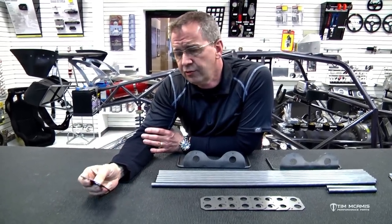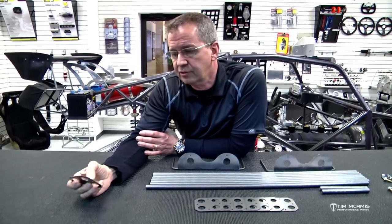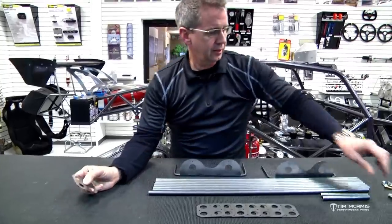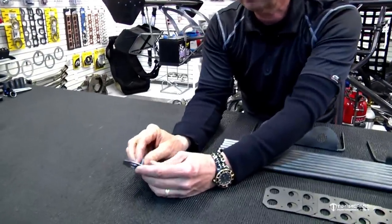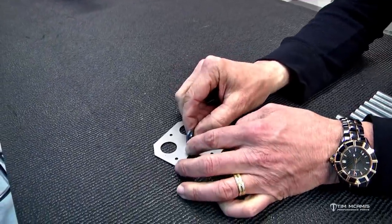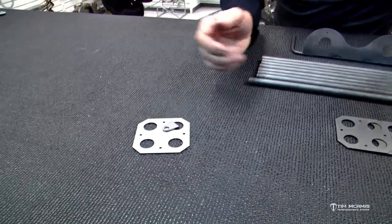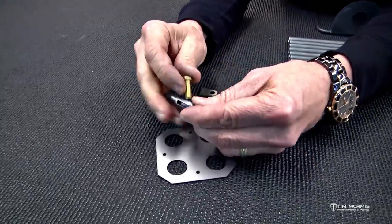It made a huge difference in the outcome of the painted car when it's done. So to do that, it's just a couple more steps, but instead of welding to this plate, this kit is going to come with the tabs and we're going to fasten a tab to this plate before we put it on the car. So we'll set these up in advance and we're going to weld this right here, and then we're going to have a little clevis that's going to go on here and then a bolt to go through here.